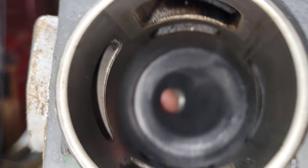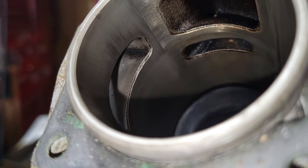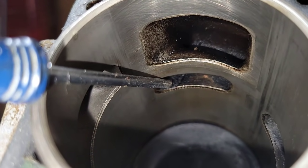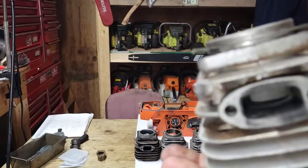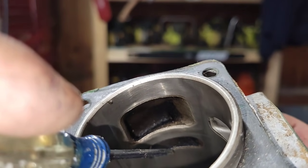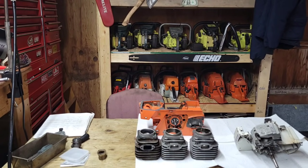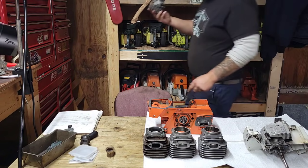Got a new camera on a new phone. You can see the soot in the upper transfer in the corner right here, and see how sooty the lower transfers are. This saw had massive blow-by — what happens is it leaks past the ring, goes through the top and into the bottom end. That's really hard on bottom ends if that happens.